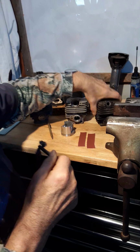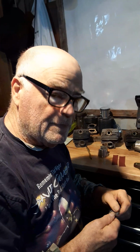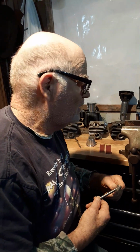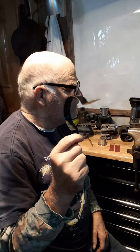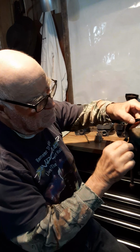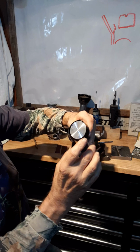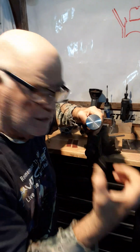And then there's some abrasives I like to use. Lapping compound, for lapping valves into the seats, makes a nice polish out of it. But okay, strapping. Remember I was big on strapping? Here's another tool made from this metal strapping. If you don't have one of these, you can make a piston ring compressor like that from a piece of strapping. Easy, free tool. All right.